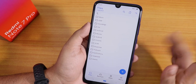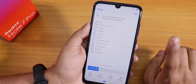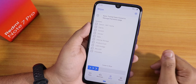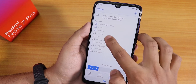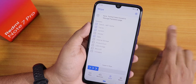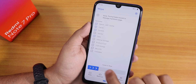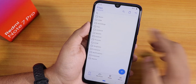Now I'm going to talk about flashing if you're coming from a custom ROM. Go to Wipe and make sure you have the latest firmware. If you don't, you need to flash it — for some ROMs you can try flashing and if you see error 7, only then do you need to flash the firmware. I'll link the latest China beta firmware in the description. I'm selecting Dalvik cache, system, and data to wipe. I'm not wiping vendor because I'm already on the latest firmware. If you're not, select vendor, wipe it, then flash the latest firmware. Now I'm swiping to wipe.